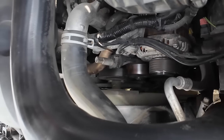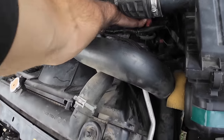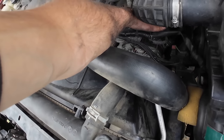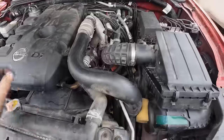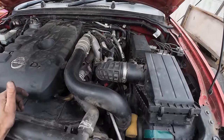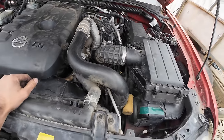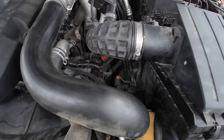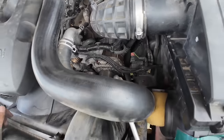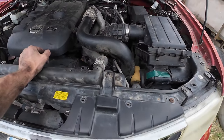It's all looking good in there — no more horrible noises, and nothing heating up now. Before, that rear end bearing was getting quite hot, and I don't know how much longer it would have lasted. So that took about half a day to strip it down and another half a day getting it back together — a day's work. But it beats paying $500 for a new alternator. They don't make it easy — I think they just want you to buy a new one. All it was was that little $12 bearing and the one at the front which is like $5, and that's just like brand new now. Job done. Thanks for watching guys, catch you next time.